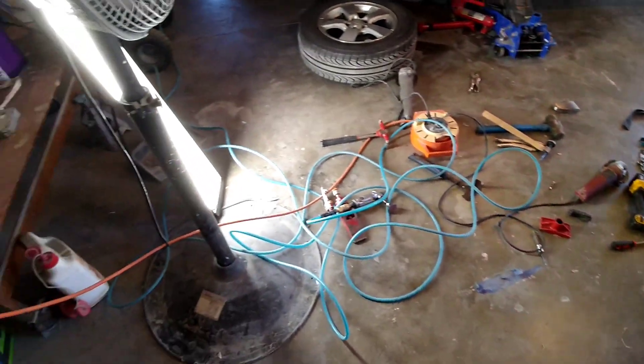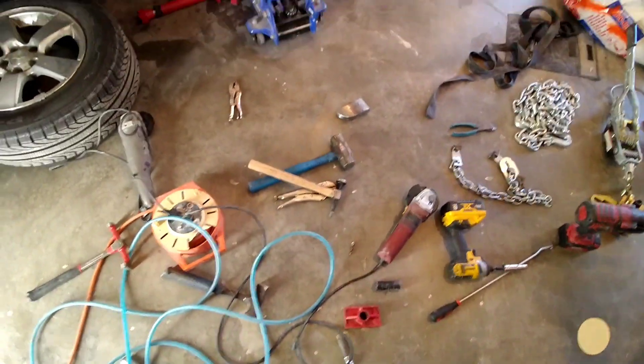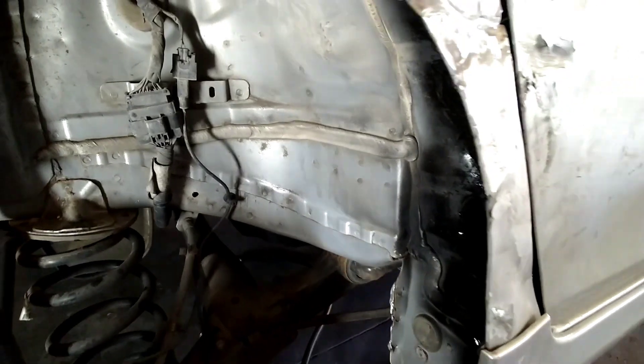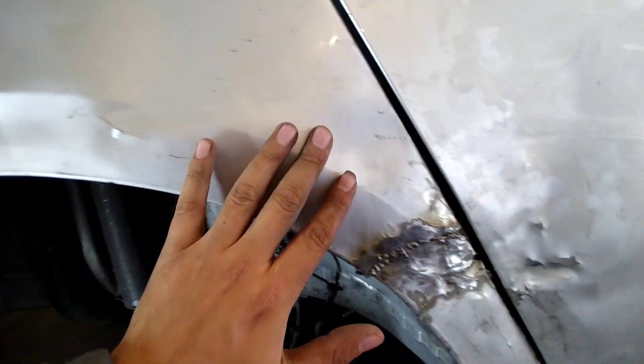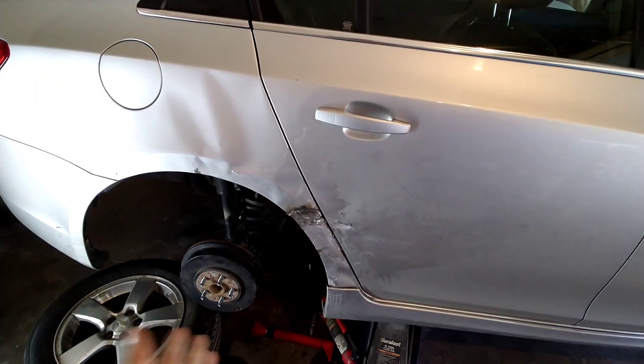Alright guys, we just put on the welder because we have a mess here — we like to make our messes. We haven't even started sanding yet. We are done pulling and pushing, and we went ahead and put some black paint on all the bare metal because we did some welding back here. We did weld right there where the metal was cut. Then we're going to go ahead and sand it. We already got our line coming in right there all the way down. We still need to pull a few spots with the dent puller, but the best part is done — we have our line.